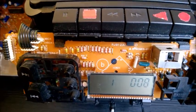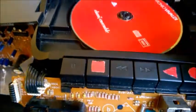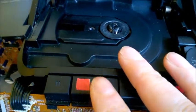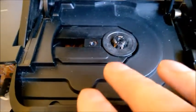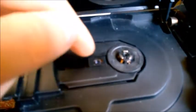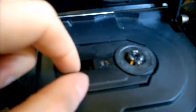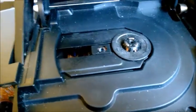Obviously this is a video and I can put whatever I want in it. It's not going to be a five-minute fix. You will need to readjust that piece of paper in many ways until you get the proper non-skipping position. The unit is sitting flat on the table — I'm not tilting it. You will need to do many, many tries. You can grab the assembly and move the paper around, checking that the gap stays even, to find the position where it's not skipping. The word that describes this is 'fiddly.'